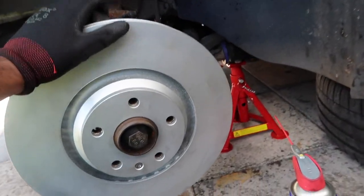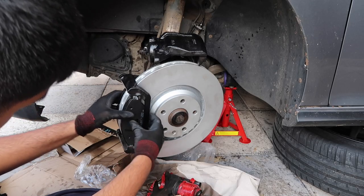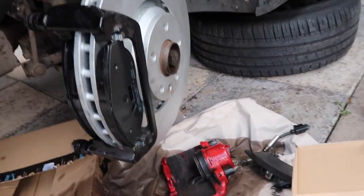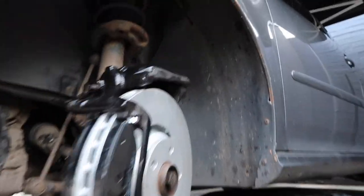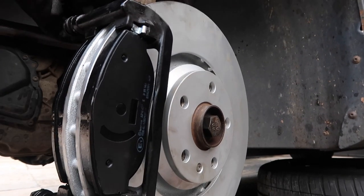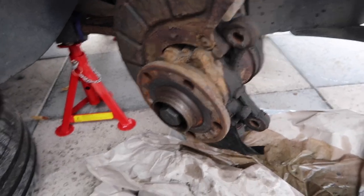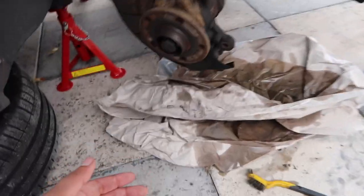It's nothing new - I've had these brakes on my older car, my S3, which came with it. The caliper bracket is on now, starting to take shape. Just these two 21 millimeter bolts here. Now that makes sense. We're going to put this caliper on here with the T45s and it should be plain sailing from there. The hardware is finally installed on the left side. This side is clean as well - there's a fair bit of muck but you can use one of these brushes. We did it on the other side so I'm going to skip ahead.